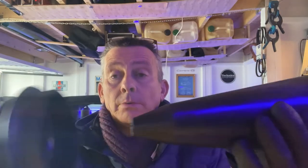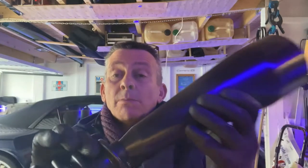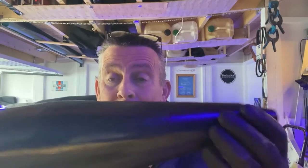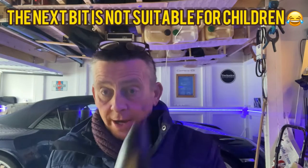Do not put it on large side first. You want to go that side first. You might find that it will fold in on itself or whatever, but you can correct that once it's on the vehicle. So now the thing to do is to grease this up really, really well, and then we'll attempt the slide on.